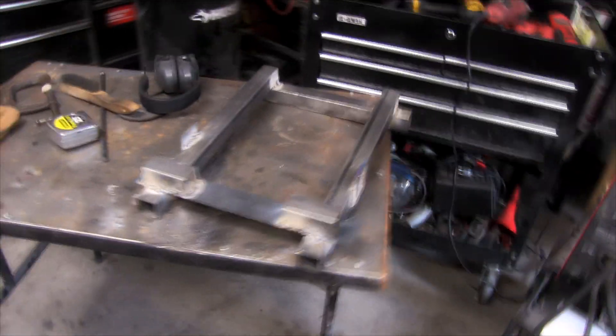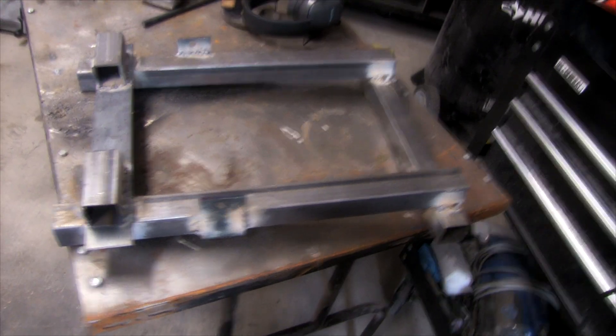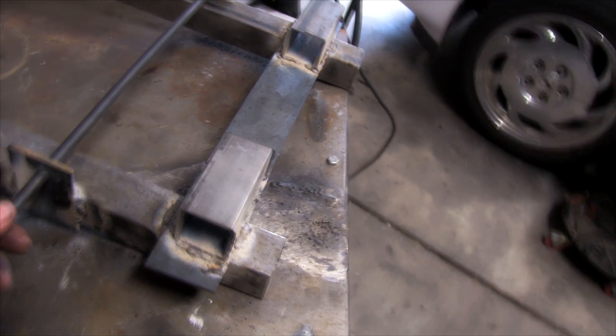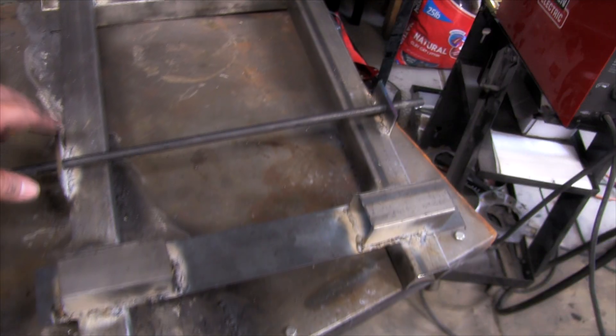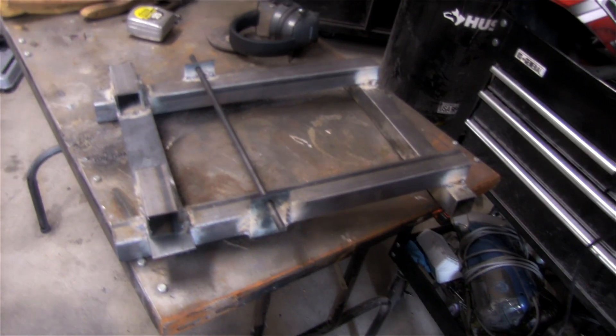Here's everything roughed in. I'm a novice welder at best, but I got it all on there — it's strong and stable. As you can see, I put tabs on the sides with holes to put the steel bar through to hold the motorcycle stable once it's on there. I'm going to drill a hole and put a cotter pin in one end and bend the other end so it can't go anywhere. I'll clean up any rough edges with a grinder so I don't cut myself, and then I'll install it underneath the bike and show you how it works.